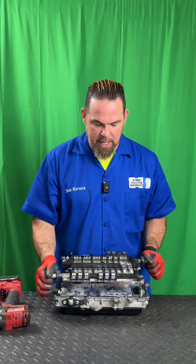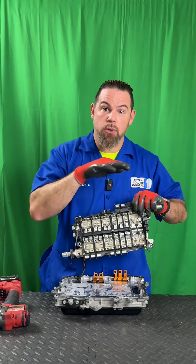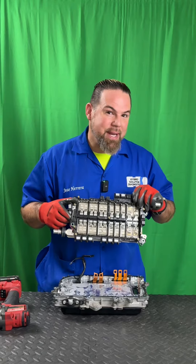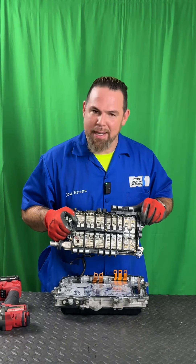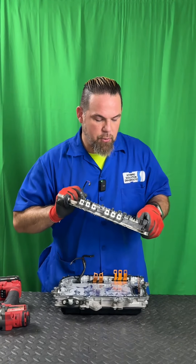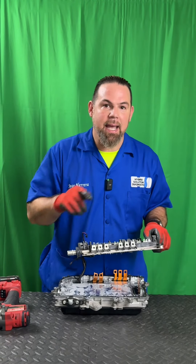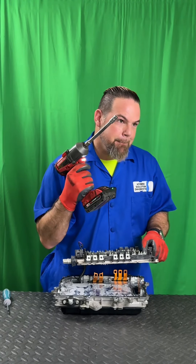In some Toyota hybrid cars, there is a replacement assembly for the IGBTs as well. This is basic electronics taken into the automotive world: to turn DC into alternating current, we use high-power transistors to switch DC into a pulse-width modulation or controlled frequency signal, simulating high-voltage alternating current. It's not truly alternating current — for each electric motor, each individual phase produces a controlled sine wave that drives the motor.